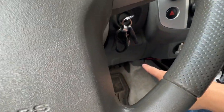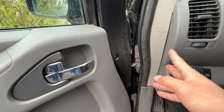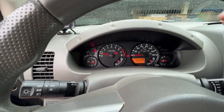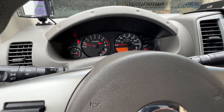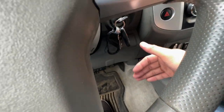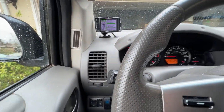All you have to do is undo these two bolts down here — there's one here and one here — and remove some of the trim. You just peel this back and carefully pop this open. There's one bolt here and one bolt over here that holds this piece, and you wiggle it out — it's kind of upwards and outwards. For older Xterra models it requires you to pull this out first and then pull this out. You just let this hang since these will still be attached, which is totally fine. Then I drilled my holes, tightened everything, and reinstalled.